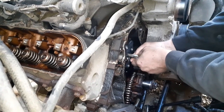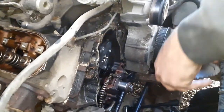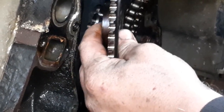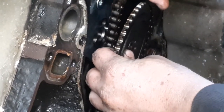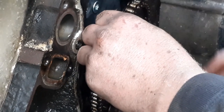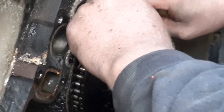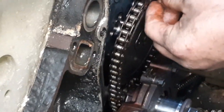We got it close. When we put the chain and the gear on it'll make it a little easier. Put your chain on first - make sure your dot's down, try to get it lined up. Once you get it on there, you can kind of snake the chain over top of it to get it lined up. Make sure you don't turn the crank while you put it on there. If you're off a tooth, just kind of snake the chain over top of the gear to change it. If you ain't lined up, you might have to move your cam a little bit.